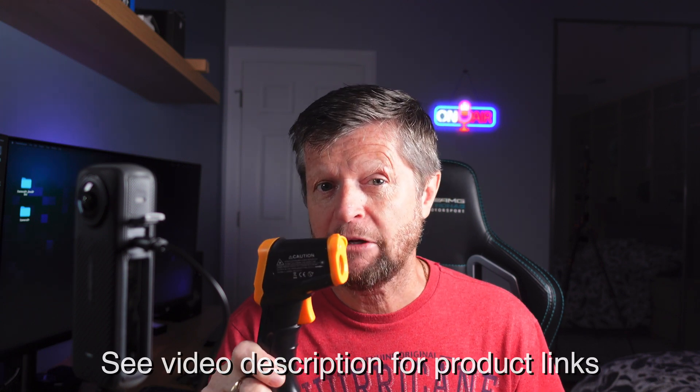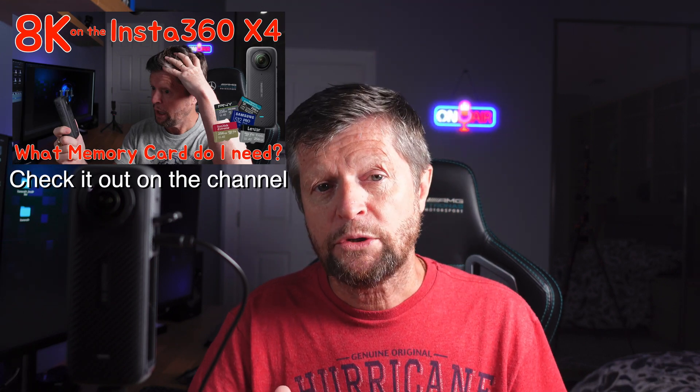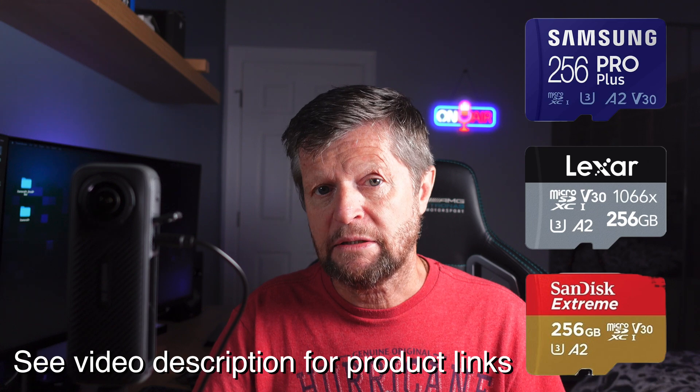If this is something you plan on using a lot, you probably should invest in an infrared surface thermometer. This will allow you to check the surface temperature of the camera and increase the airflow as needed. In my testing, the hottest point on the surface of the camera is the area between the logo and the status light. One final thing to mention is to make sure you are using a suitable memory card — if your memory card lacks the required speed and struggles to keep up with the writing during recording, it will also contribute to more heat generation. I did an entire video focused on this, so check that out on the channel. For today's tests I was using a Samsung Pro Plus 512GB card, but I've also had great experience with Lexar Silver Series cards and the SanDisk Extreme cards, and I'll place links to those in the video description.